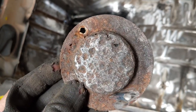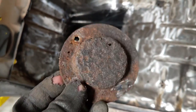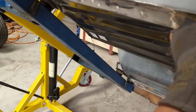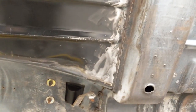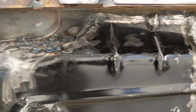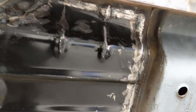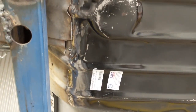That's the floor pan done. I'll just quickly show you the underneath section. I might go through — because you don't often get another chance to visit it from the back — and in the areas that I think could be reinforced, I'll go through and add some welds on the back end. Those ones that are just welded, I'll knock those back. And that will be it.